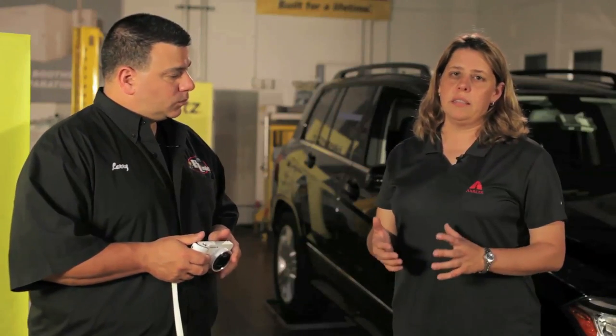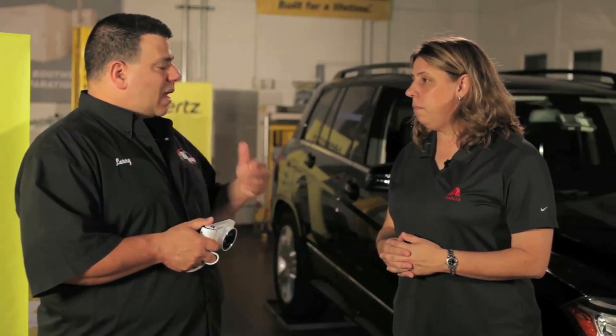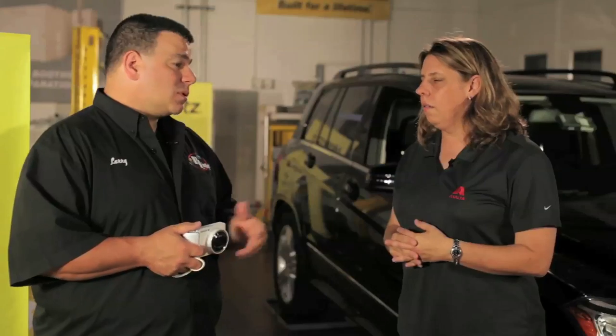Keep in mind that flash will often overexpose pictures, especially when shooting inside engine compartments, around the suspension, or under the car. When it's dark under there, the flash fires and you get a bright burst with no useful detail. Having a handheld or secondary light source with you — even outside in sunlight — makes a big difference. With enough light bouncing off surfaces, the camera's metering may not fire the flash at all. LEDs provide the most light and are especially helpful for backlighting or flooding an area so the camera can take a clear picture.